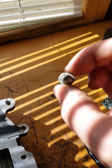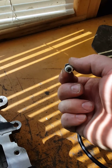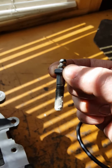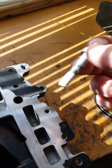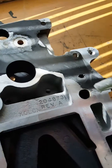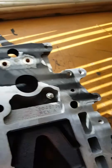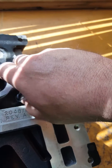With the vise and my cordless drill, drill a hole all the way through the bolt, then re-drill the top, tap it accordingly, and put a greaser in — and that's your tool. I don't have any Teflon tape on it right now; I usually put that on the threads and I'll tell you why in a bit. Basically, all you do is screw that down inside — you can screw on the bowl or the zerk fitting, whatever.